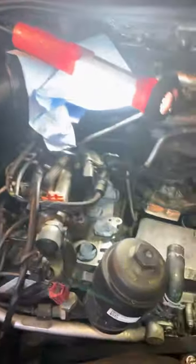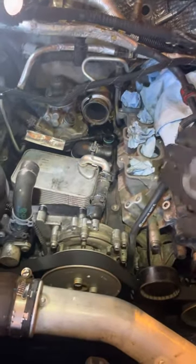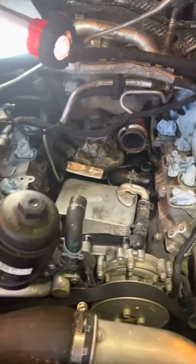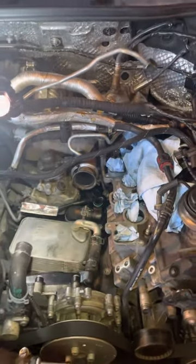It is really clean now. I let it soak in some kind of cleaner — I think PBW — overnight and scrubbed them pretty good. They're pretty nice now. Assembling all this is a real pain — there's just a lot of interference here. To take the intake manifold off, I'd recommend getting new seals for it; I ended up kind of tearing one. I took the fuel rail off over here based on some other YouTube video I watched, and also these glow plug connectors — took those off to try to get some clearance. You can't take this off without taking the whole front off; this gets in the way, you don't have room. There's just all kinds of stuff, a lot of little things to take apart. I hope this helps you.